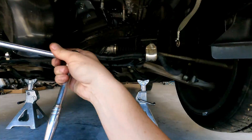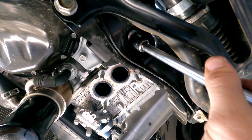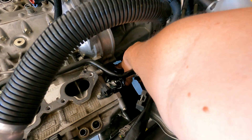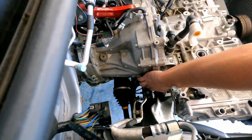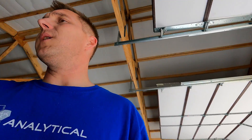Okay so on the motor mount nuts there's one here — obviously it's a 14 — and one right there. I'll do those first; it's not going to go anywhere, it's sitting in there. As far as bell housing bolts — I've already got two of them out for the starter. There's one right back down in there and there's a stud right beneath it with a nut. Same thing over here — two up top, one right there, and then the other stud is right below it. So I'm gonna get the two nuts off the studs on the bottom and then move on to getting the hoist hooked up before I start getting the remaining bolts loose.